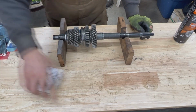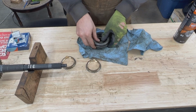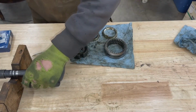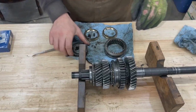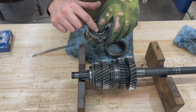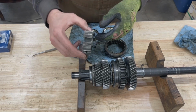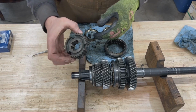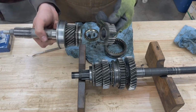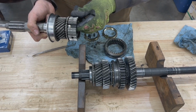We're going to prepare our other hub. So before we assemble it, I want to show you something here. This hub, unlike the other one, has a direction. So you see this end here is protruding a lot, and this end is sunk in. So it is very important to put it in the right orientation. This one is the right one, with the protruded part towards our input shaft. Because you see here, there's room for this protruded end to go into the shaft.